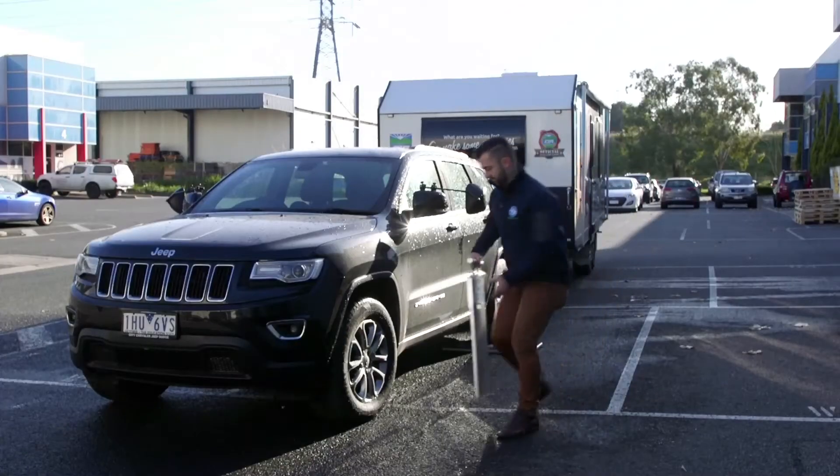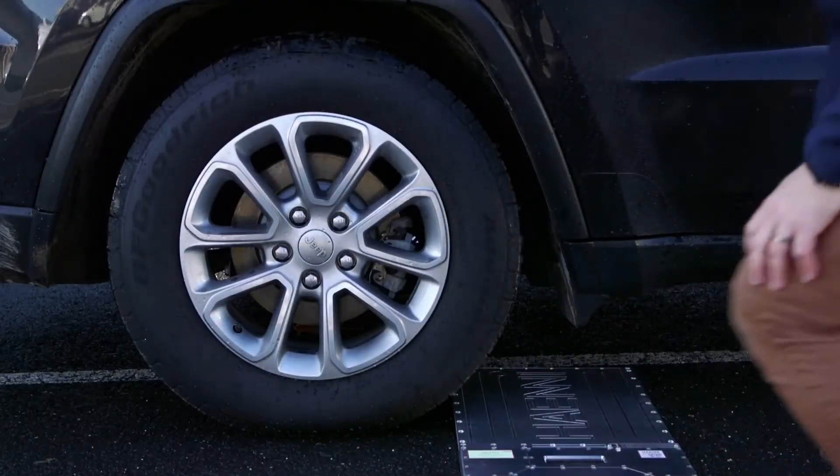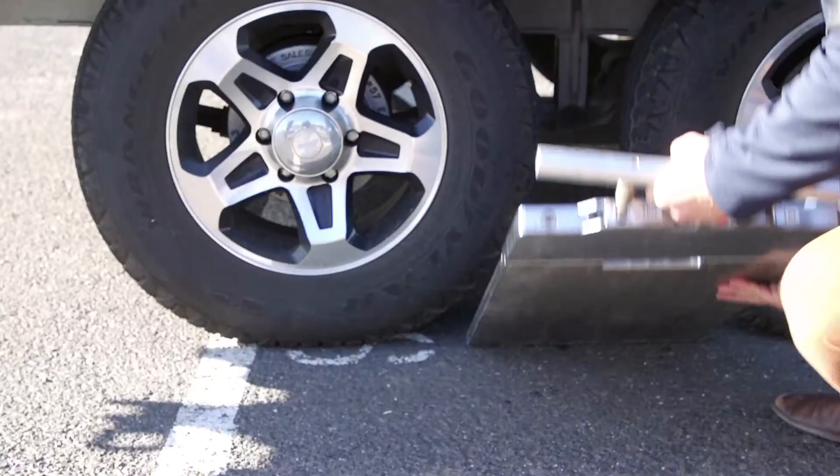For your GTM, you've got to ensure that you're on level ground. We're on bitumen here, which is fine. If you're on gravel it's not going to work because those rocks are going to get under your scales. If you go to a weighbridge you're going to be fine because you've got that better concrete surface.